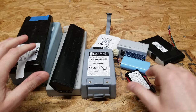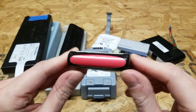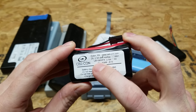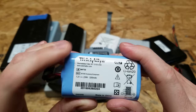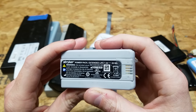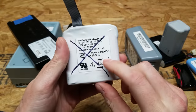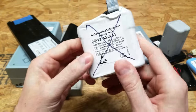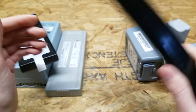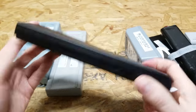The larger ones will likely be the most interesting to open. Small battery packs like this, I can tell they are standard Sanyo 18650s based on the wrapper, and I see a rating of 2.4 amp hours. This one tells you the exact cell model number and is rated at 3200 mAh, so this should have some pretty good cells inside. There's no amp hour rating on this one, but we do have 39 watt hours. This one's got an X through it, which may indicate a bad battery. Based on the size, this is probably a 3S3P, so I'm guessing these are 2000 mAh cells. Here we've got 6000 mAh at 11.1 volts, again probably another 3S3P.